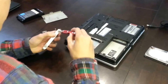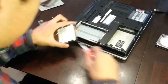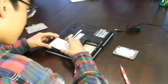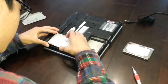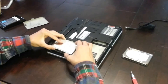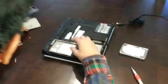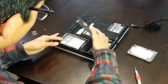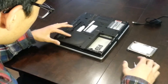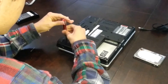Then place the hard drive and its case back in its original position. Once this is done, screw all the remaining screws back in their original position. Reattach the battery.